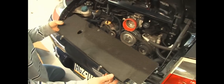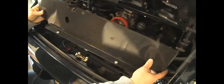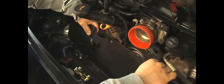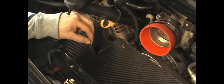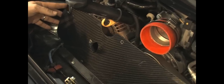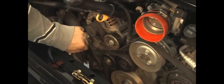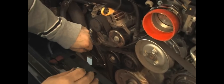Now we take our heat shield and we lower it into position, lining up the two rubber bushings into the holes, and then we reach back to the support tube and line that up to make sure it comes through. As you can see it's a little loose — this way and that. We line it up so it looks centered on the center line, then remove the heat shield and carefully tighten it in position so we know the support tube is on center.